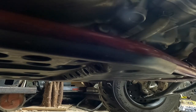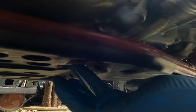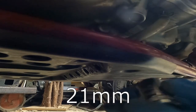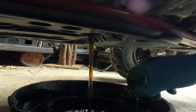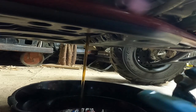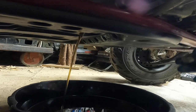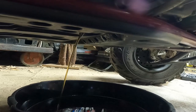The next step is to go up under here and find your case drain bolt. It's going to be different on some models, but you want to come right here. This is the next bolt you're going to drain. For this one I'm using a 22-millimeter socket. It's almost impossible not to get your hands all greasy — you might want to wear gloves. You're going to let that drain for a little bit, close to empty if possible.